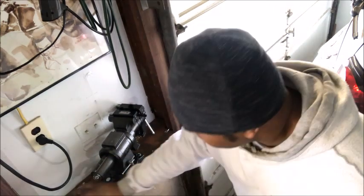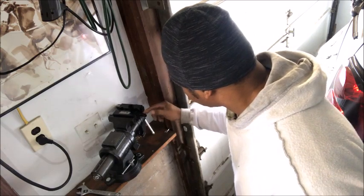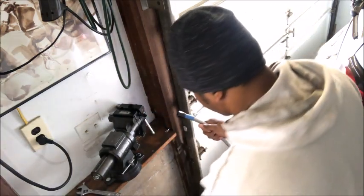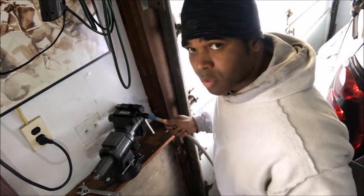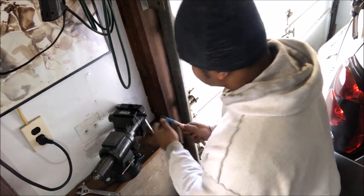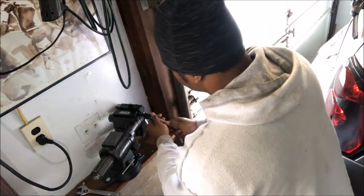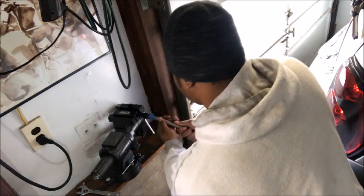What you wanna do, got a lube, got my little oil here, lube up the fitting a little bit. You wanna take this, and you want to make sure you'll feel once it gets in the hose. See? I felt the hose opening up for this. So get it in there, and we're gonna straighten this out.